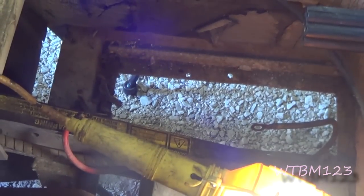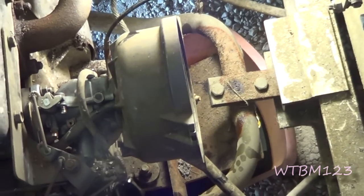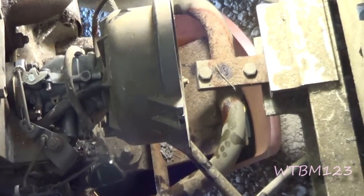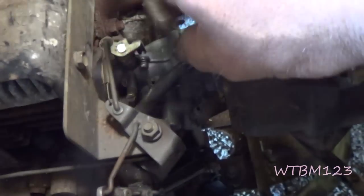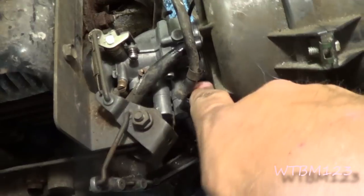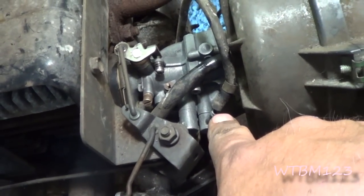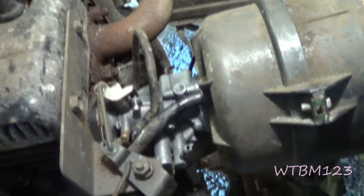Now we've got to put a little petrol in there and a battery to blow the air cleaner out — that's what I'm going to do now and put it together. You just put the filter element in here and put the three screws in. I'm going to go ahead and fill this carburetor full of gas. This is the bowl vent, so I pulled the hose off of there. Anytime on a carburetor, if I can fill the bowl vent full of gas so that the bowl's full, it'll run longer. I like doing that better than just dumping gas down the carburetor.